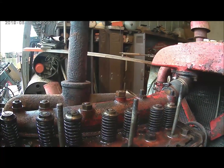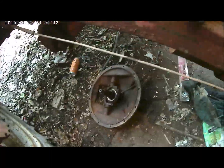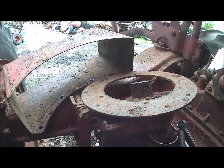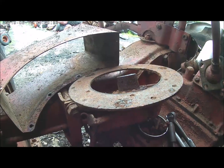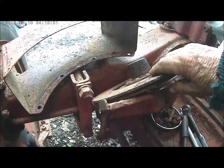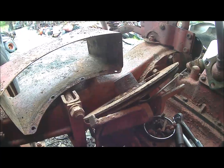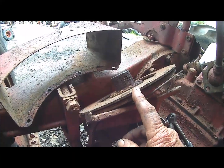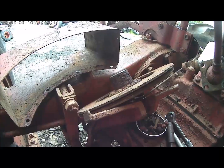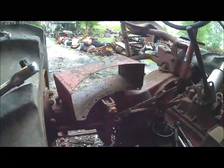I might have to pour it on top of some of these pistons later on. This morning I got the clutch took apart - there's the cover. Found out I'm going to have to get a new lining. Rivets are either worn out or rusted away. The clutch plate's good, so I'll have to get a new lining. That's not a major expense - the lining is like $30. But if you get one with a clutch plate and lining already together, it's like $110 more. That clutch plate's worth $110 core charge.